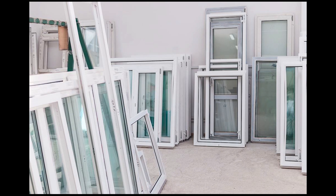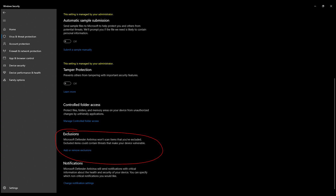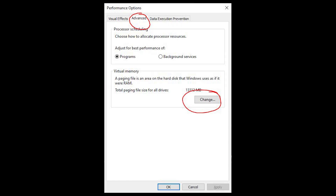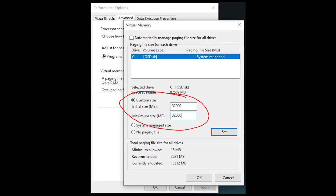Install Windows next with a bootable USB. In the power settings, disable sleep mode and add your miner of choice to the exception list in Windows Defender. Lastly in Windows, go into Appearance > Advanced and change the virtual memory to the total VRAM across all cards. So if each 3070 has 8GB of VRAM and you have 4 of them, set the custom size to 32,000MB for both the initial size and maximum size.